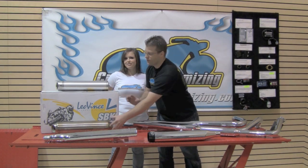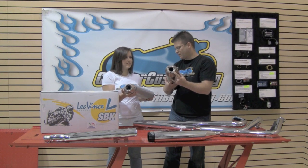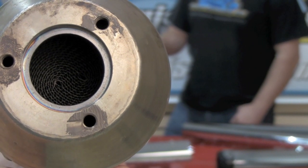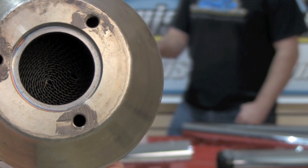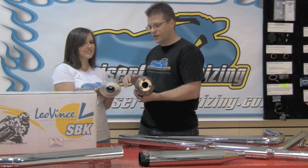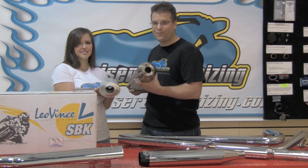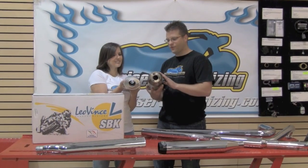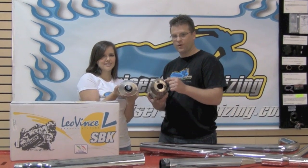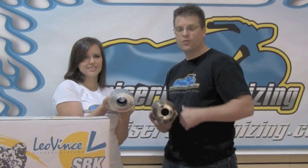Take a look at this set of slip-ons right here. If we can zoom in and take a look at the insides of both of these pipes — as you can see on the inside of this exhaust pipe off my KTM, the honeycomb material here is actually the catalytic converter. By removing the set of exhaust pipes from my motorcycle and going with an aftermarket slip-on I've saved over 20 pounds off the back end of the bike. That was a significant difference. You can see from the non-visibility through the middle of this pipe versus this pipe over here, you can see straight through — the increase in airflow you're going to get is significant.